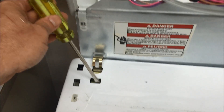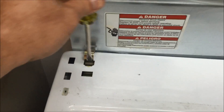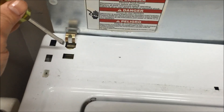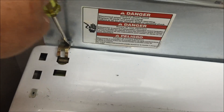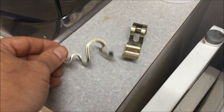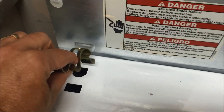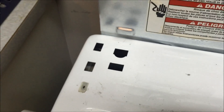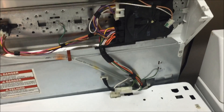The lid's up, the cover's up. There are two metal springs, one on each side — just press a screwdriver in on that side to release it. Now you want to pull the whole body of the machine off. These clips keep the body in place, so release the front, then take a screwdriver and press in the back to push the clip down and out. The right-hand side fits into the metal notch and this part fits through the two notches in the front, keeping the lid in place.